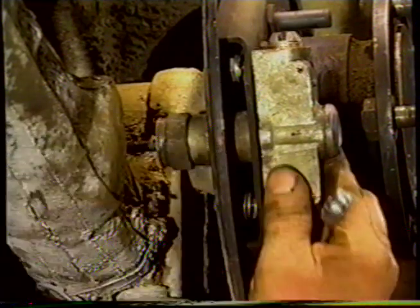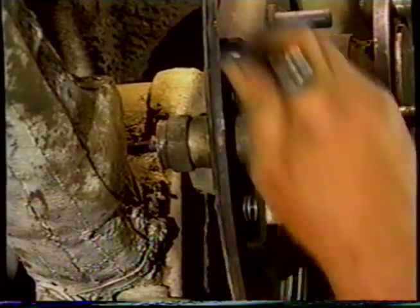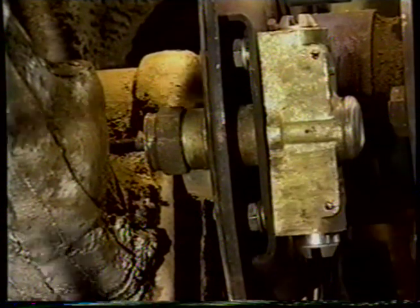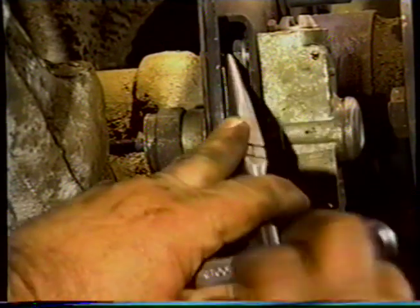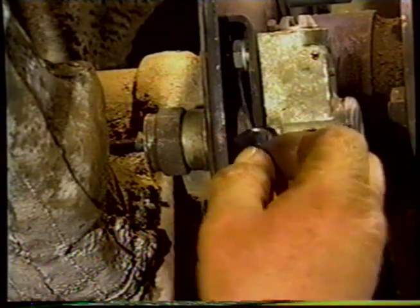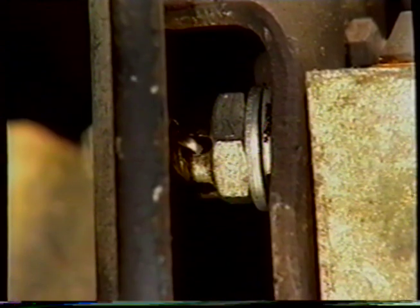As I said, you've got the Thackeray washers and this is fully floating. This moves up and down all the time, so it self-centers. We're going to pull them in and the Thackeray washer will give us our movement. So we just pull them up till they're snug, and then we have to put our split pins in. We push those in. Now we'll take a small screwdriver and bend out one leg. Once you've got your split pins bent, that'll complete that part of it.